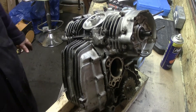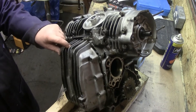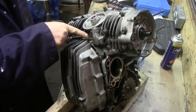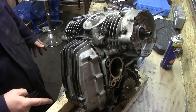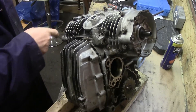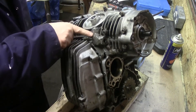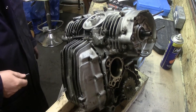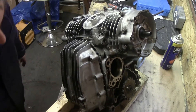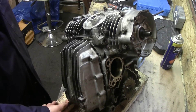Now that the bolts are out at the top, I'm taking the bottom crankcase bolts out, but I've elected to take this sump off as well. Bit of disappointment - this area here has obviously had some damage in the past, it's been welded, and there is a lot of oil around the bottom of the engine. That may just be over the years, or it may be leaking out of there. I'm going to have to get that tested by some engineers and if necessary do a bit more aesthetically pleasing welding on the bottom. But that'll all get done after it's all been aqua blasted or jet blasted or sonic vapored or whatever they're going to do. So at the moment I'm just going to take this sump off and take it from there.